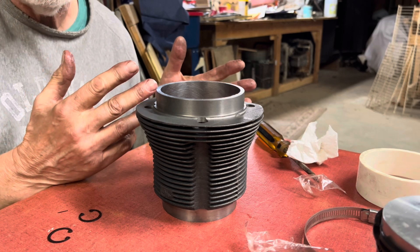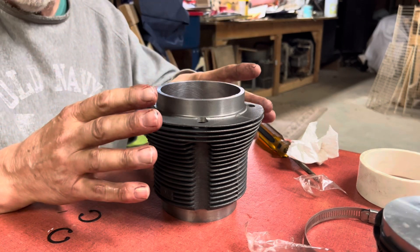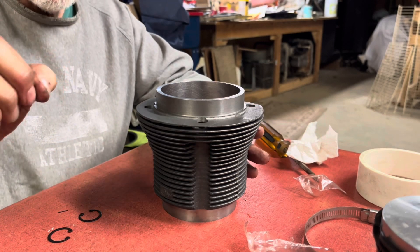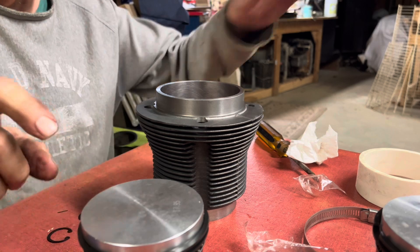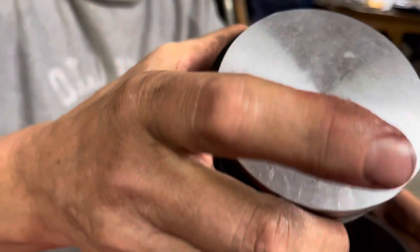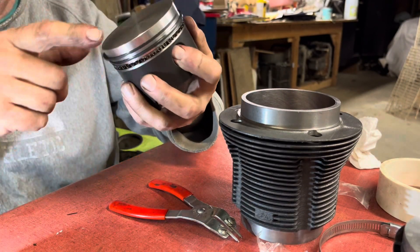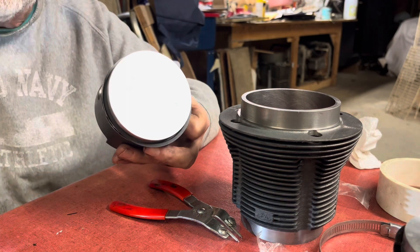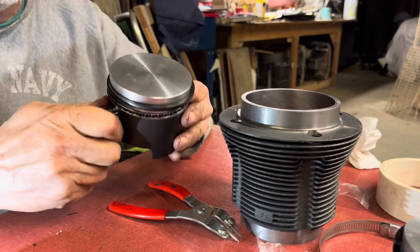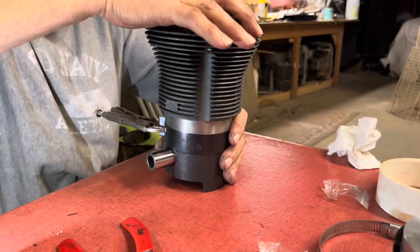The cylinder installation I just showed you is the way I've done it my whole life — I built my first engine when I was a teenager and have always dropped the cylinder over the piston. Until recently I saw someone do it a different way that seems like a good idea: start by pre-planning where the cylinder is going and which way it needs to face. For the number two slot, arrow towards the flywheel — it'll go in like this. With our snap ring installed on the flywheel side, we can take our wrist pin, put a little oil on it, and get it started.